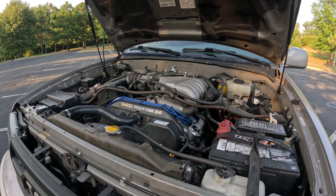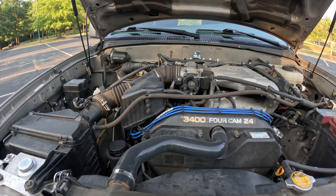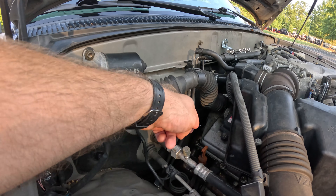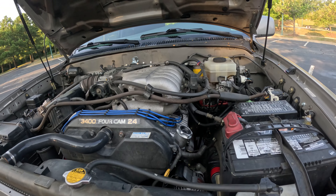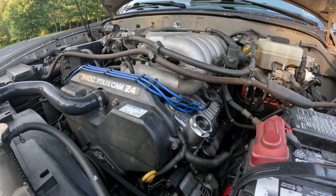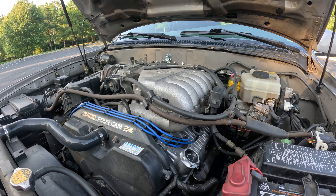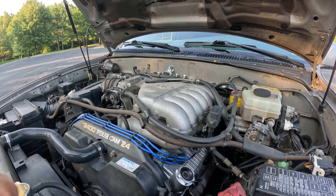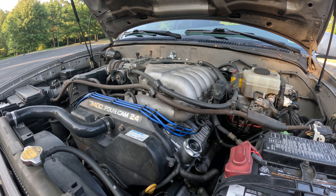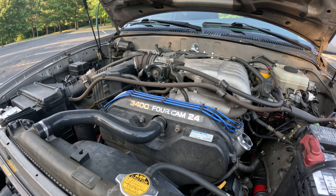Some of the things you can tackle — as you can see, this valve cover is a lot shinier than this one. These have the common issue where the bolts come loose. This side started to leak a little bit back in early spring; they were tightened down. When I first got this 4Runner, this valve cover was cracked and already leaking. Whoever owned it before took it to a shop and cracked the valve cover trying to fix it, so the whole valve cover has been replaced with a new OEM one.